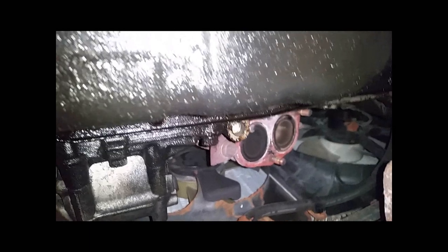I need to remove the splash shield to get clearance. Up here are two push-pin plastic clips with 10mm bolt heads. These two come out, the shield moves out of my way a little bit, and then I can get to all the oil pan bolts. Let me get my 10mm ratchet and swivel socket — actually my swivel socket's not here, so let me go grab my stuff.